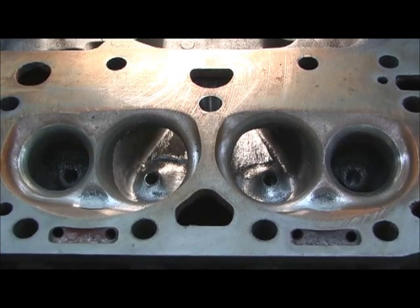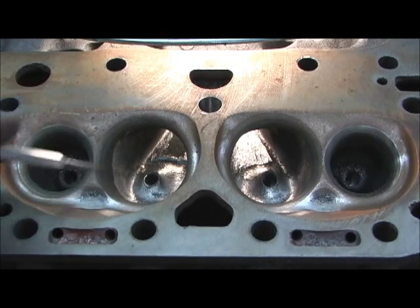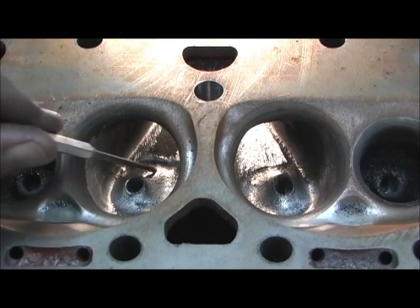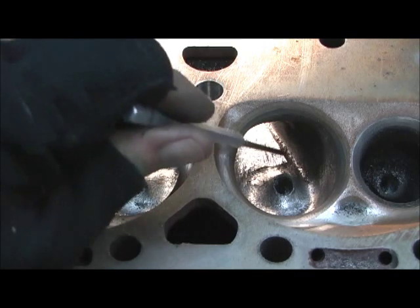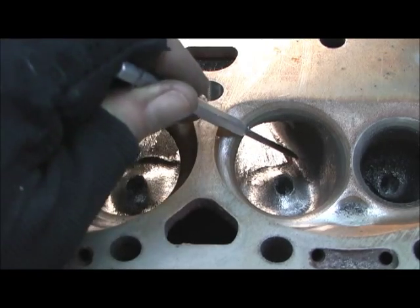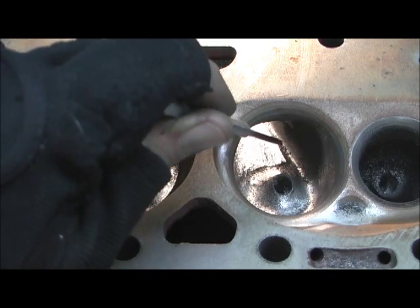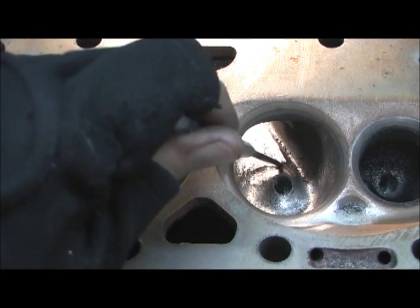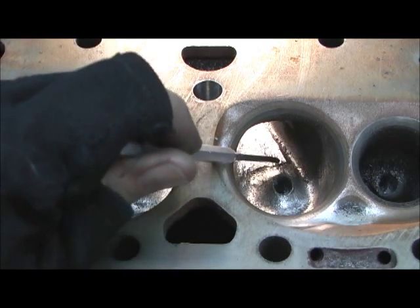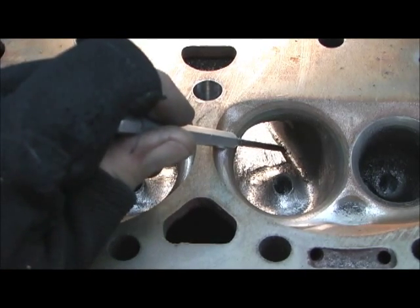I've turned it the other direction — one side done and one not — so you can see the comparison. You can see the ridge here. Let me get a little closer: the dramatic 100 to 125 hump. On the done side it's almost level, but there is a little bitty dip right here — that's what I aim for. I don't want to connect the dots. I want to leave that small dip because when you're looking into the port you can see where the light isn't as shiny. I'll then take my egg, go in there, do my blending, and check measurement heights to get them close to equal.